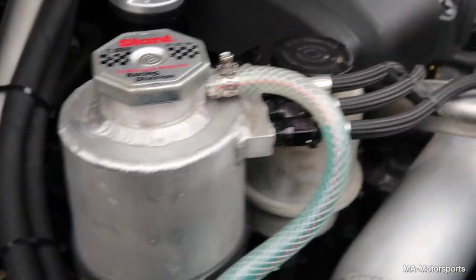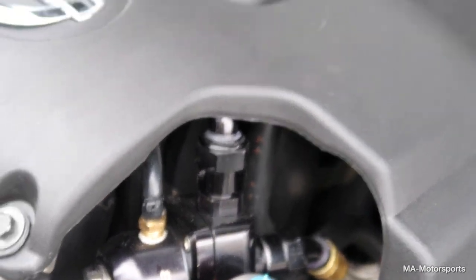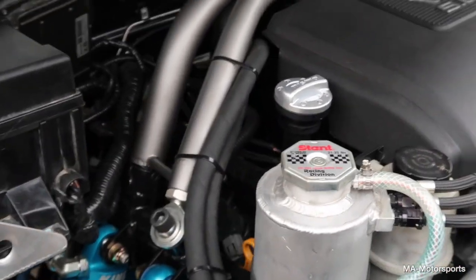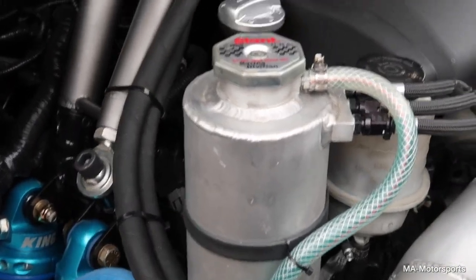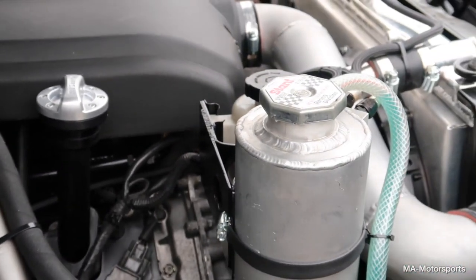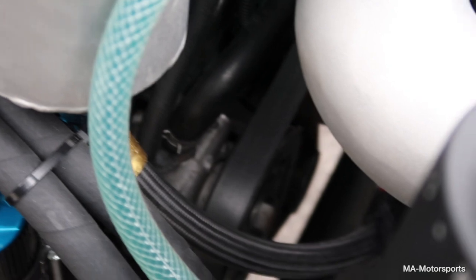All the fuel runs through XRP hose and fittings — Pro Plus XRP stuff is awesome, we try to use it on everything. XRP fuel filter mounted under the truck on the frame rail. The cooling system is plumbed to the radiator with a couple of ports on the engine we modified, and we have a coolant header tank mounted up high. Our experience with the VK56 engine in racing applications has shown these things stay a lot cooler when you keep the air bled out of them — 100% the case. All plumbed with XRP hose down to the bottom of the radiator.